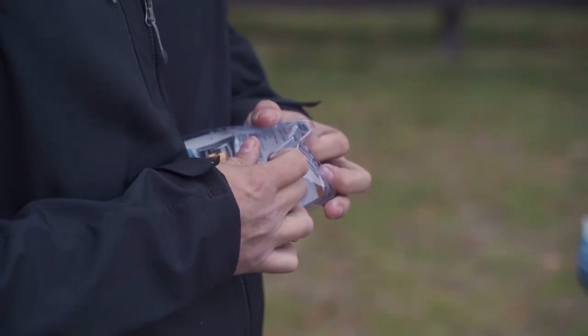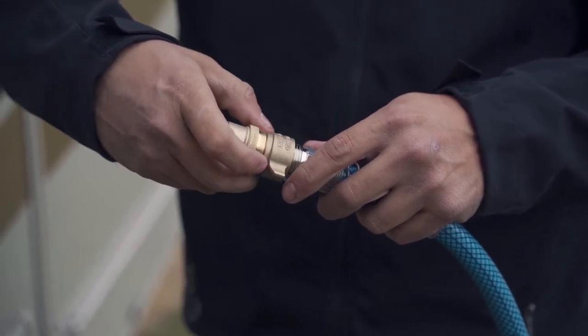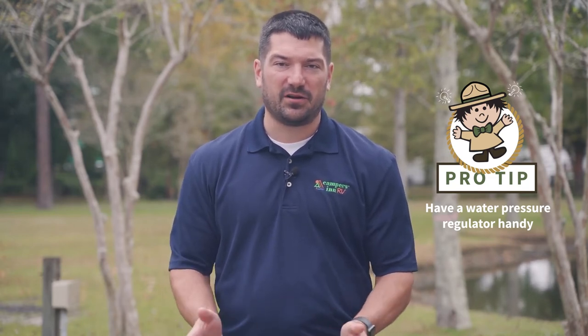On the site side, there's a nozzle meant for fresh water and sometimes a black water tank flush nozzle — do not hook up to the black water flush, as that's for dirty water. An aftermarket item I'd recommend is a filter you can attach to your fresh water line. Also, especially important down south, is a pressure regulator — very cheap, just a few dollars, but it prevents blown lines inside the RV from high campground water pressure, which can really ruin a trip fast.